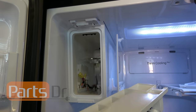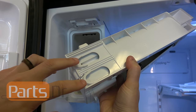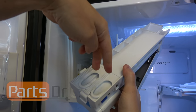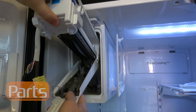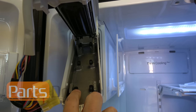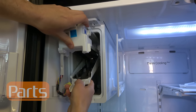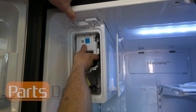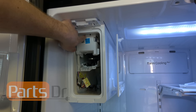To install the ice maker, first make sure you have the bottom tray open. Note these two slots — they're going to line up with two pieces that stick down from the ceiling and will slide into these slots to lock it into place. When you put the ice maker in, make sure the coolant loop goes through the opening in the back. Also make sure you have all the black rubber pieces — there should be six of them on this bottom tray. It should click into place with the top notch once it's in the correct position.